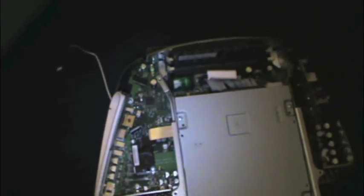Oh, right. There's one difference that I completely glazed over because I actually, honest to God, forgot. The 1.42 gig eMacs use DDR RAM, which marks Apple's switch to DDR RAM. That's all well and good, but I can't use my PC133 memory on the stupid thing. Which means I now have to obtain more memory. That's okay, I'm sure I have some lying around somewhere in my scrap piles of hell.